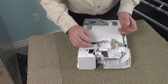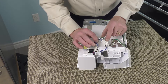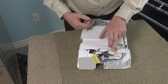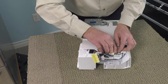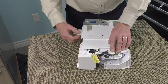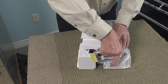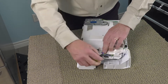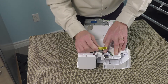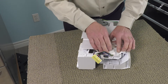With our harnesses connected, our next step is to position this connector properly in the housing. We found that if we put the release tab face down, which puts that side of the harness facing up, and tuck the excess wire down into this opening — I suggest just taking a piece of electrical tape or duct tape and taping across that. That will help secure it in place when we go to reinstall. There will be a little bit of strain on that, so secure it as best as possible.